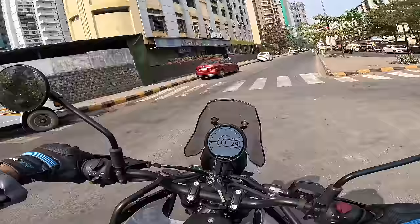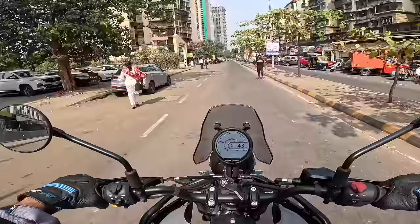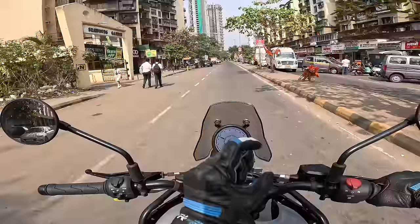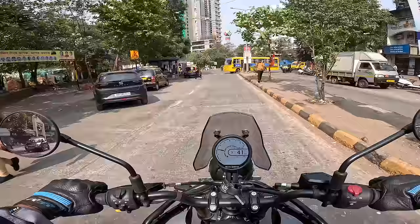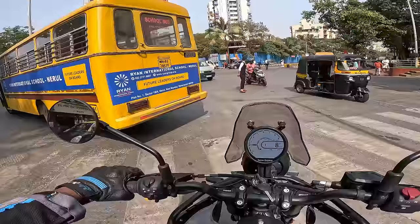This is the first Royal Enfield engine which gets DOHC, yes, dual overhead camshaft, and it is the first Royal Enfield motorcycle engine which also has an aluminium bore and a forged piston. But that's not all. This is the very first Royal Enfield motorcycle which is not long stroke, because the stroke is now shorter. It's not very short. It's not a short stroke engine, so it's an oversquare engine. So this is a 452cc engine known as the Sherpa 450, single cylinder of course.